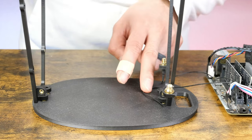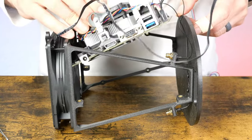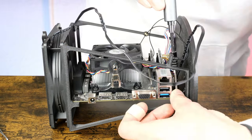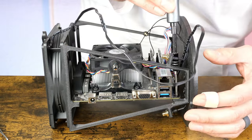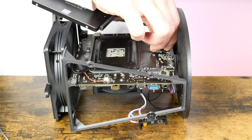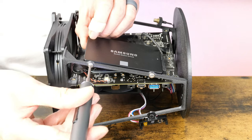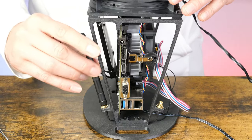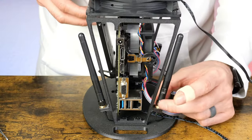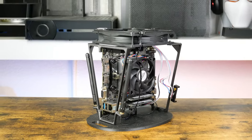Now I'm attaching the rest of the parts to the PC frame base. It's a little awkward, but the motherboard should slide right in with some massaging. Screw down the motherboard nice and tight, then screw the power button nice and tight too. Snap the serial ATA connector in place, then you can screw the hard drive as well. Spin the WiFi antennas on and you should be done manhandling the PC for now. Even without the leg, you now have an STX frame that will keep nice and cool.